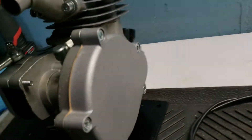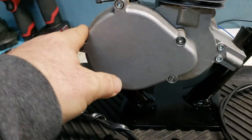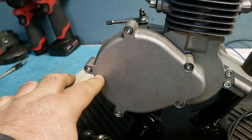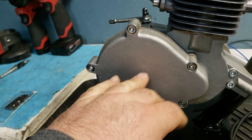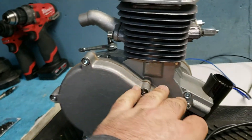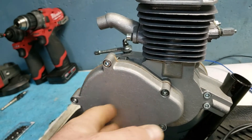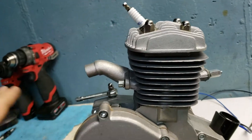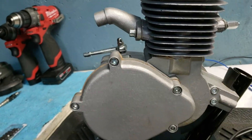On the clutch side, I take the cover off, lubricate the gear real lightly, make sure everything's tight, and lock-tite the nut that holds the big bevel gear on. I make sure all this stuff is tight and the clutch is perfect. So when you get this motor, it's absolutely ready to be put on your bike.